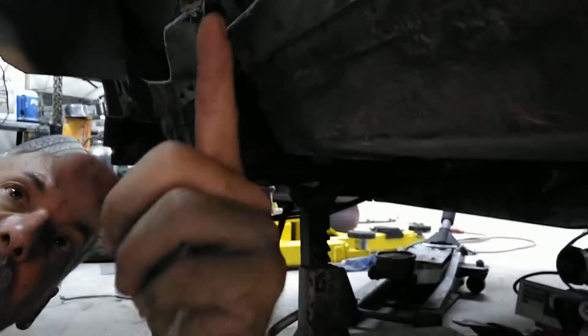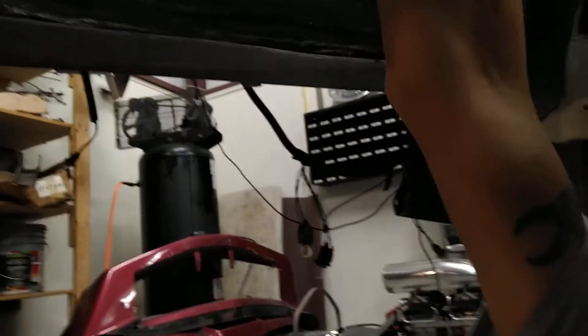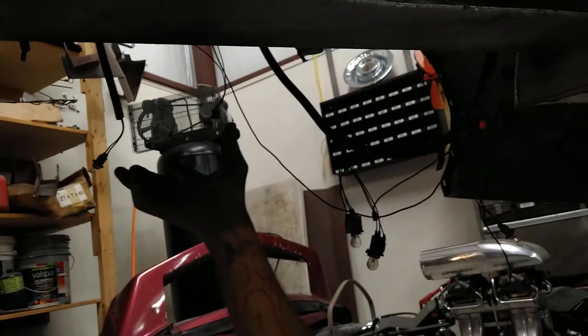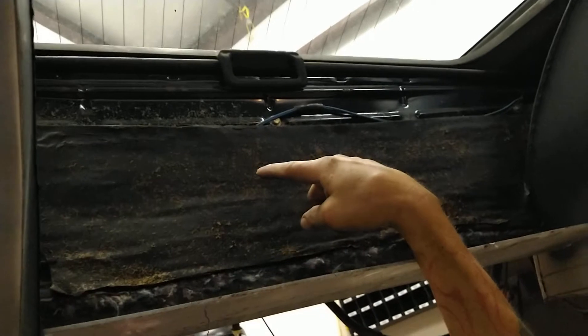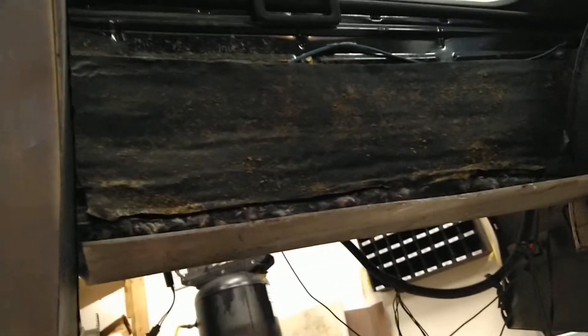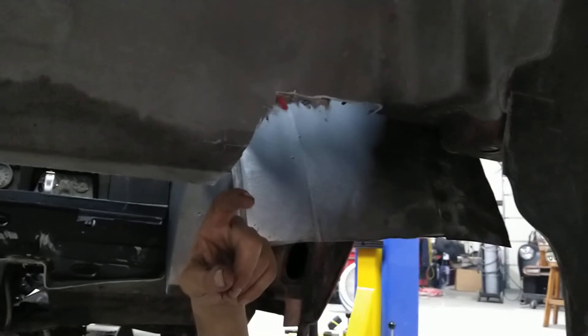Hook them in here where the frame rails are going to sit. I have to do a little bit more fabrication to fit everything in, then we're going to run them up and over and they should come out about right in this area. We're going to run roll cage tubing back here; the original frame is going to be bolted back here because we're going to put the gas tank back in the factory location. Those tubes will run into this cross member that we're going to install. We're going to run another cross member across here and that's where we're going to put the tubing for the roll cage.